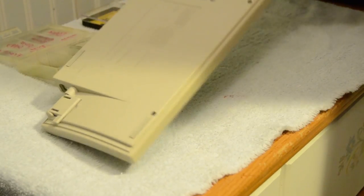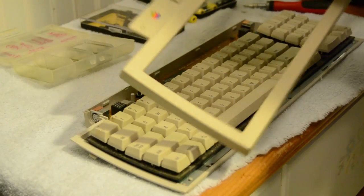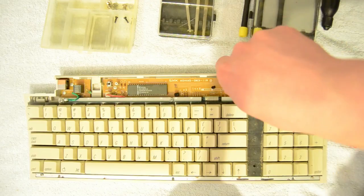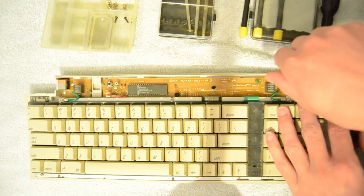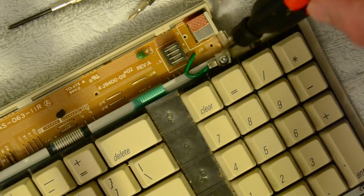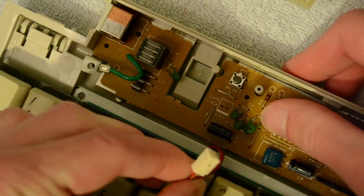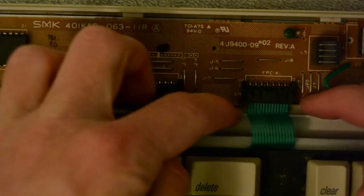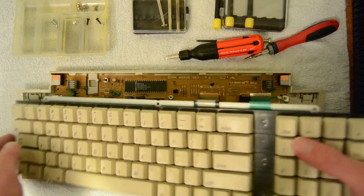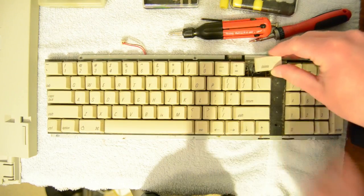Next comes disassembly. I started with the keyboard by just removing these three screws from the back, which caused the front casing to come right off. Be careful about the power button at the top — it does just kind of fall out and is held in only by a spring. Once the front of the keyboard is removed, you can start removing other components such as the keyboard itself and the circuit board. I started by removing the screws holding the circuit board to the back casing, then removed three screws holding the keyboard down, then removed the two-pronged connector and the two ribbon cables. Once that's done, you can just slide the keyboard itself right out, then remove the circuit board by gently lifting it from the two ADB ports.